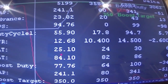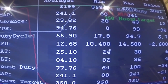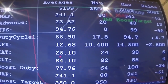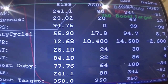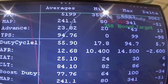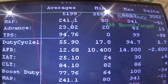I have one more log to show you. Boost went up to 341 KPA - that is just over 2.4 bar. We started at a minimum of 24 degrees and it only raised to 30 degrees on that 2.4-bar run - just a six-degree difference. The only reason this recorded a smaller increase in temperature is because the higher boost meant the car had more power, which means the run was shorter, so there was less time for the intercooler to heat-soak.